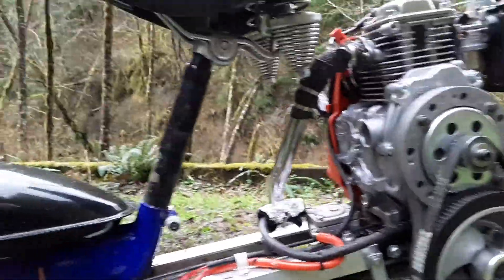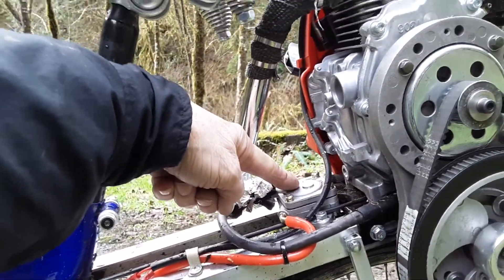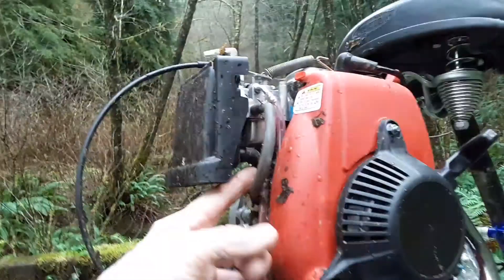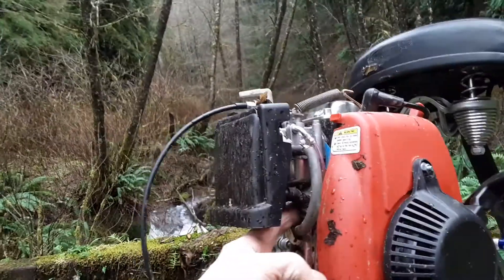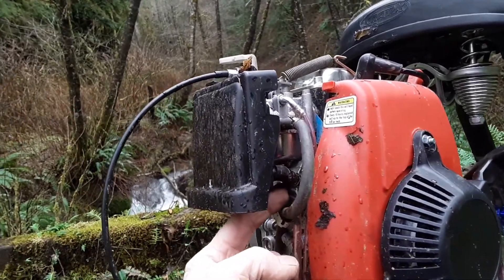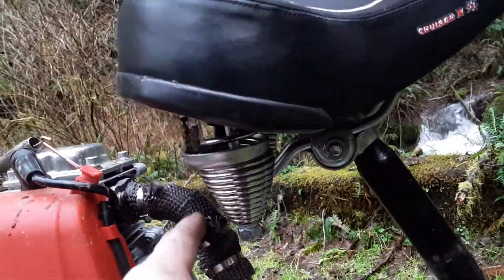I have the gas tank down here and it got loose — I need to put another strap and tighten it. I had to use one of these little vacuum pulse fuel pumps to run my fuel up there, because the carburetor is above the gas tank. To get my vacuum pulse, all I did was run the vacuum pulse to the blow-by vapor line into the air filter. I put an orifice in there to give me a little pressure differential — that's really all it needs to see. So it'll pump the vacuum back and forth — that gives me my vacuum.